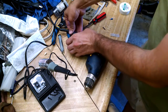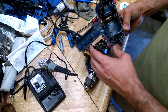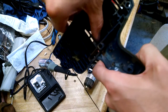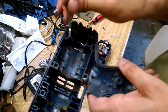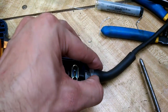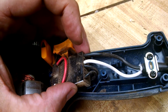Now it's time for the reveal. Sometimes you can just get your fingernail right under the frame — you want to try to bring it all up at the same time so you don't crack the case. And there you go. You'll notice there's a couple little spots that have some lubricant in there; that's a good thing. You'll see some bits of dust and dirt, but it doesn't really matter unless it's really caked on and hard. This is what we're going to be dealing with: you have your strain relief right here — the external boot strain relief. And right here is the switch. You've got your black and your white wire. Most drills don't have a grounding.